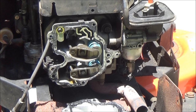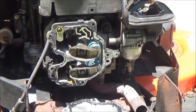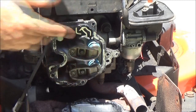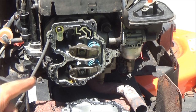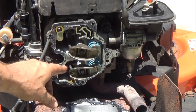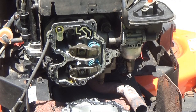Still a little hot, but these things feel tight - they seem to be way too tight. I'm going to check the specs on these. These are called rocker arms - I'm going to pull the rocker arms off and the push rods out, and we're going to check the push rods to see if they're bent.